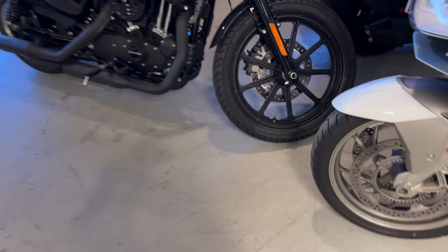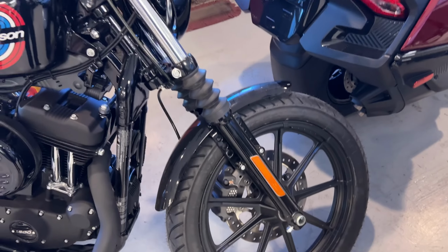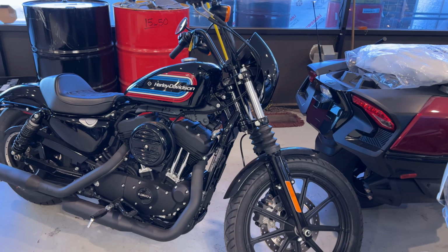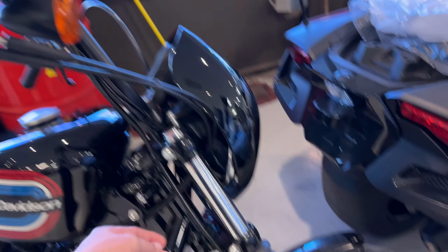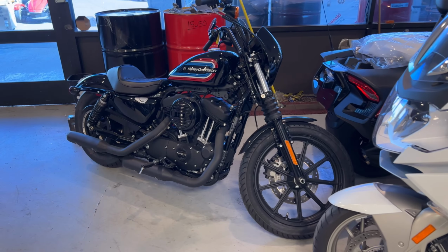You can see all the coloration in that rotor. She's done. I can't show it here, but the rotor's loose. It just needs to be replaced. It has 500 and something miles on it. But we're just going to get the master cylinder, the hose, the caliper, and the rotor. Just going to get her done.